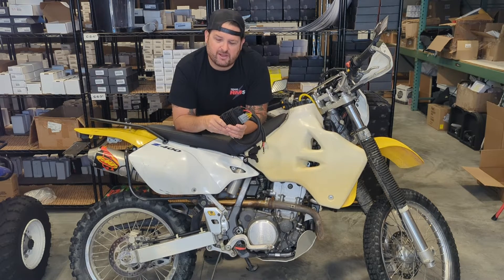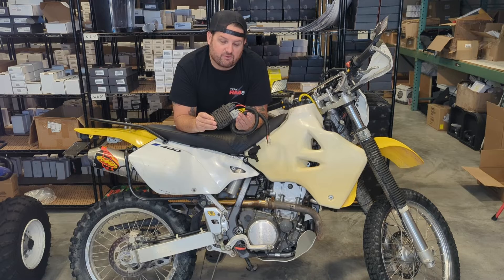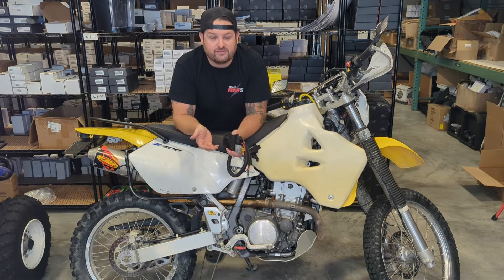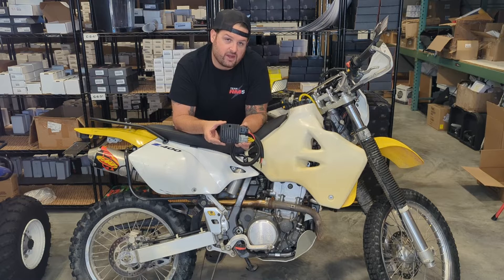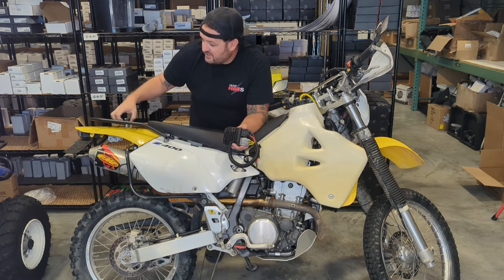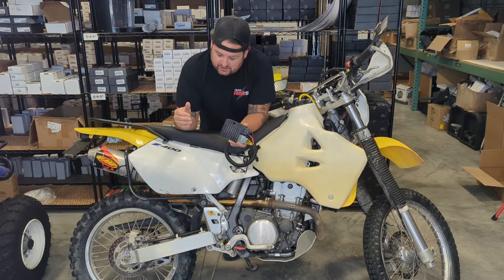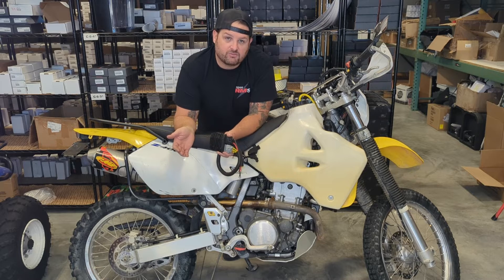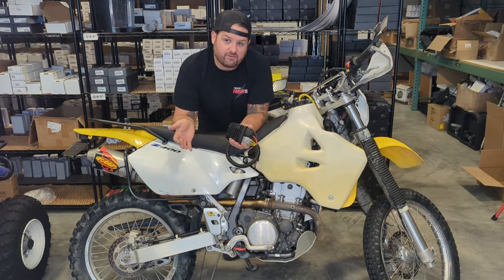There's a pretty common modification on these bikes called the free power mod, which basically is to directly hardwire the regulator to the battery and bypass the vehicle wiring — and we're making it really easy for you with this kit. We have a DRZ400 here that we used to prototype and test on. The DRZ doesn't have a lot of options for mounting a larger regulator, so it's really up to you where you'd like to put it. We've run it through the mountains in Colorado on the Alpine Loop Road, and it works excellent.